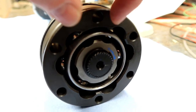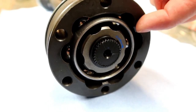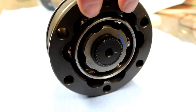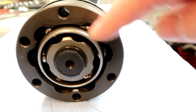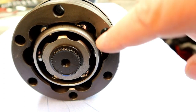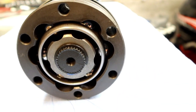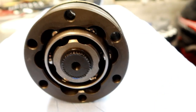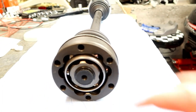If you see here, there's a big narrow, narrow, wide portion of the axle. And if you look at the other side, it's the same: wide, narrow, narrow, and a wide portion. This is not correct. It should be wide on this side, narrow on this side — opposite every other time.